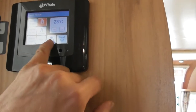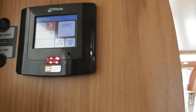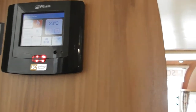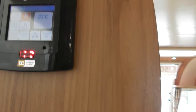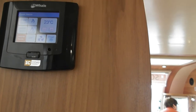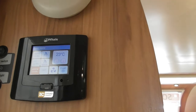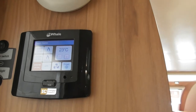You've also got a fan on its own. With the heating on and an energy selected, the fan will only come on when it needs to boost the temperature. I'll put it back to electric now. So you've also got fan — if you just want air to circulate without any heat. It's also got a frost stat as well. So if you've got that switched on and in the night it goes below — obviously near frost — it'll kick in. I don't know if it's like 4 degrees or something like that.